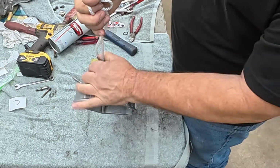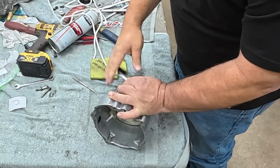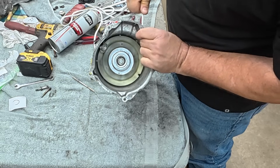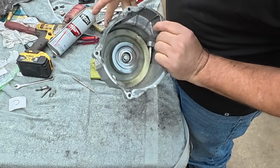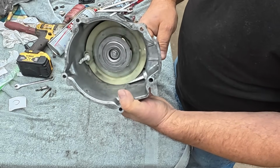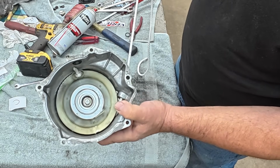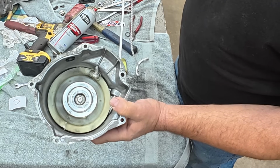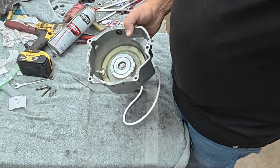All right, we'll check that at the end of travel one more time. Feels good. Spring didn't go kaflooey. Everything's happy. And that is the maximum rope, because you can see it's like out of the pulley, wedged into the case. So when I actually tie it off in the sled, I'll pull it out a little bit so it's not rubbing on the case. I'll pull it out yay far, 8-10 inches, and then tie off the handle. Good enough. Put it on the motor.